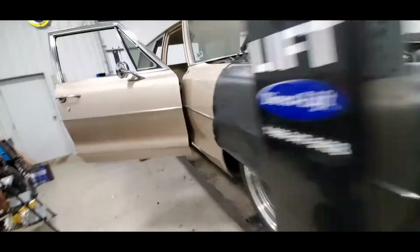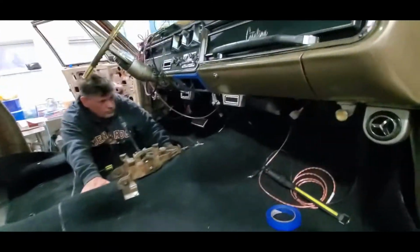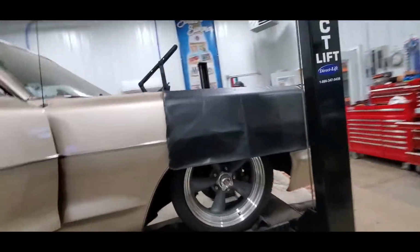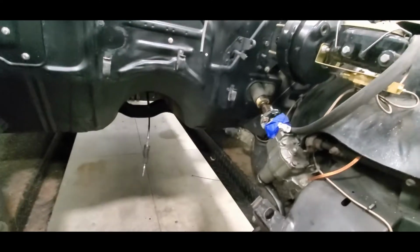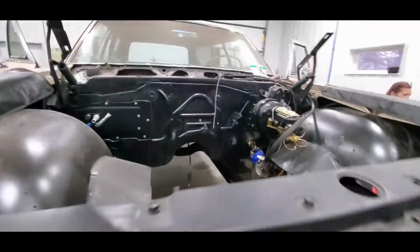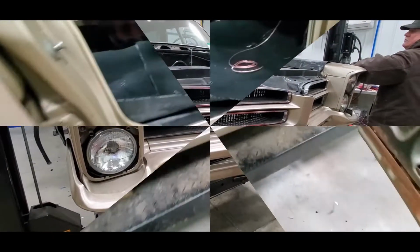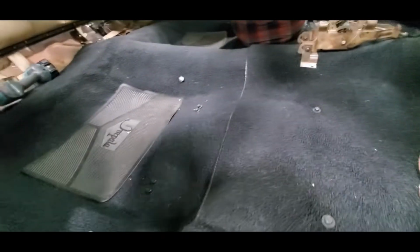Okay, I'm getting ready to crawl under, and because of the style of accelerator pedal, there's 2 studs that go in the floor. So he's going to push that. I'm going to crawl into the engine bay, heat up another drift, just like we've been doing with everything. And then there's a plate down there that has 2 drilled holes in it. I'll shove it through, and then we'll have those exactly located. Right. It seems like a lot of work, but we finally have it all burned in.